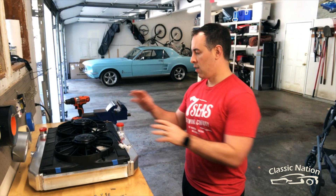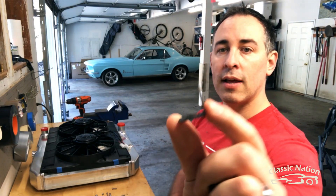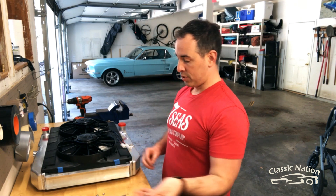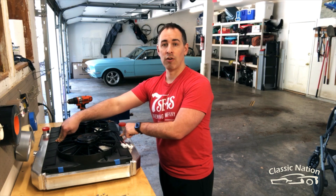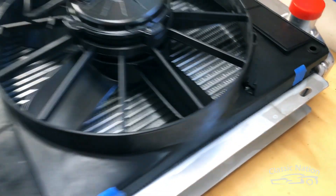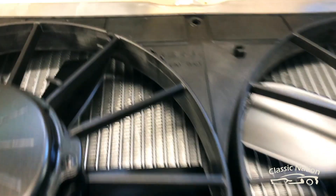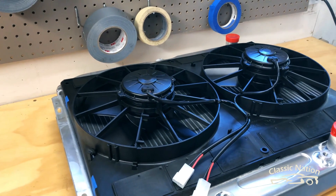Here's my game plan for fastening this electric fan shroud unit to my radiator. I picked up four little metal L brackets from the hardware store — I drilled a hole in the correct spot. I also picked up four retainer clips to fasten to the plastic shroud, and I've got stainless bolts and nuts. Four clips go on each exterior corner, and then I've got two straps that'll go through the middle and secure it. That'll be a nice lightweight way to anchor the fan securely to the radiator.